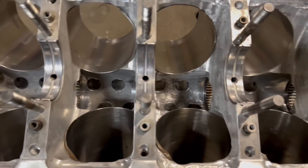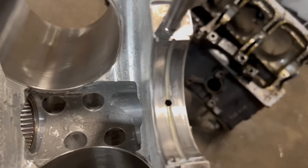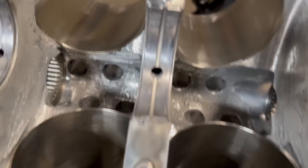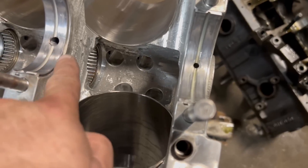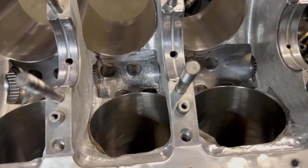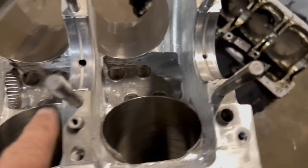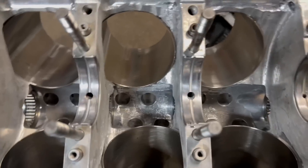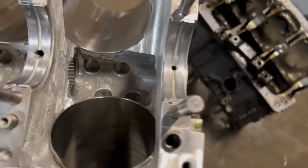One other thing I decided to do — I didn't do this on the other motor because I didn't think it was that far off — look how small that hole is on the spacer bearing versus what I just did. That hole was very restrictive compared to the size of the block. I don't want the oil pushing on the back side of the bearing like that, so I'm drilling the spacer bearings out to get more oil to the main bearing going in there, which already has a larger hole.